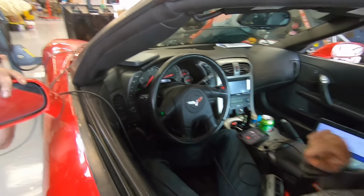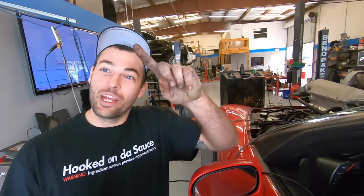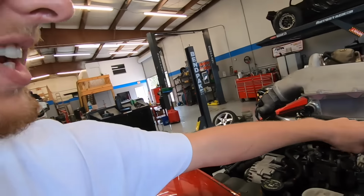You get this oil pressure, 80 pounds through that run? 80 pounds or above. Because it tacks out at 80 PSI. It didn't go past 80, it was right at 80. She's doing it. Good job, Jeremy. We've got to get our tach signal reading right.